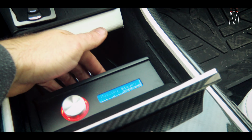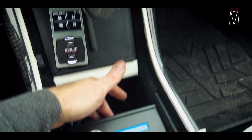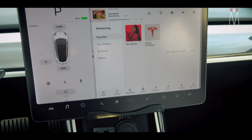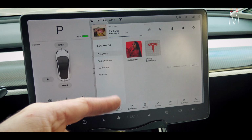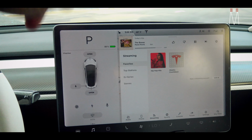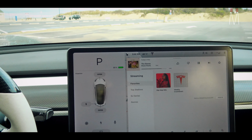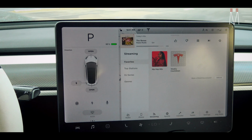We left the center channel on a switch, which we have down here, which just connects the center channel back up to the OEM system. And the reason we do that is so if you get a phone call and you're on preset 2 or preset 3, not the factory radio, you can still have that phone chat very quickly on that center channel. You can still get navigation prompts, autopilot prompts, all that kind of stuff there on that factory center channel. So keep that in mind.